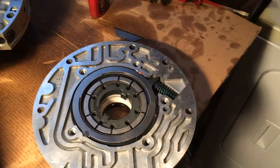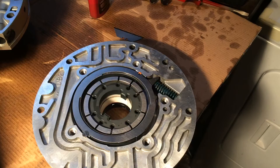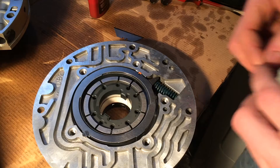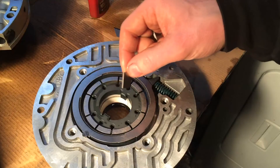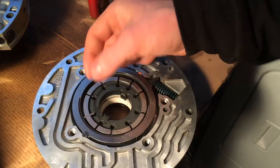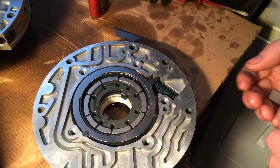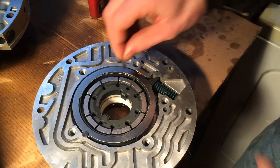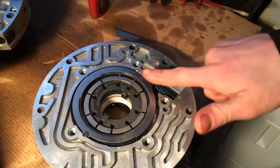It's going to sit in the bore — the same bore as the bushing and seal. Now that you have your guide in, next will be your vanes. Remember to keep everything coated in ATF. One little trick I've learned: if you put them in over here where you don't have a whole lot of room and they don't seat, put them in over here where you have the larger cavity. Then whenever you turn it, it'll push that ring back and it'll kind of center itself. You want it flat across the top.